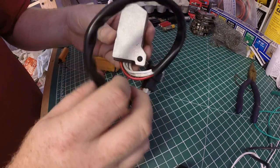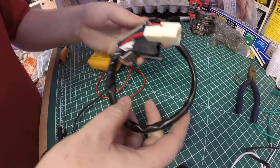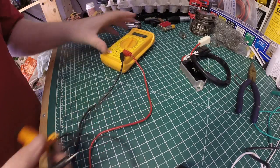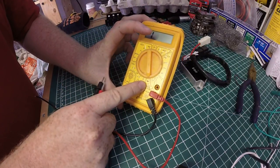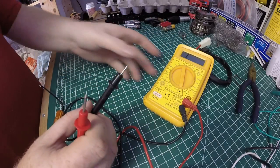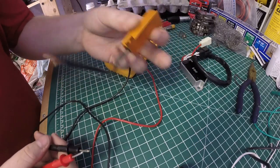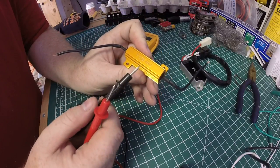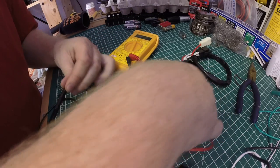This is what your rectifier looks like — it's probably dirtier than this; this is my replacement, some cheap Chinese knockoff, the best eBay can provide, for not like a hundred dollars. The way to test it: use your voltmeter on the continuity setting — it'll beep if you've got perfect continuity. This is a load resistor used to simulate the resistance of incandescent bulbs when switching to LED — it should pass current but not trigger the beep.